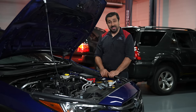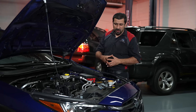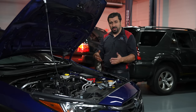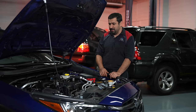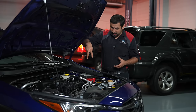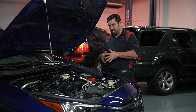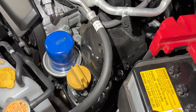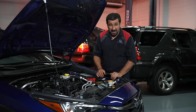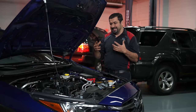This engine has direct injection only. I wish they had implemented the D4S system from the BRZ/Toyota collaboration into all their cars, but understandably they didn't want to use another company's system in their mainstream lineup. Because this is a boxer, the direct injectors sit right on top going straight into the cylinder head. There's a very accessible high-pressure fuel pump in the front — a relatively simple system, though it may develop carbon buildup issues under certain driving conditions.